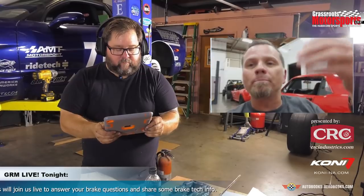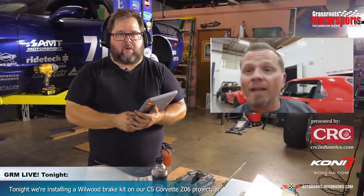That's really important. Once we do those 2 more stops, which is also a nice time to check your bias and make sure that no wheels are locking up, on this particular car not as big of a problem because it's got ABS. Right. After you do those stops, you want to look at the rotor and make sure we've got some bluing or purpling coloring going from the cast iron rotor where it's trying to dissipate into the aluminum hat. If we've got some coloring there, we know that even if the brakes are smoking, and sometimes they will, that's totally fine.